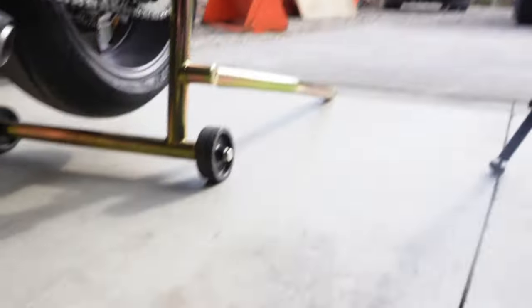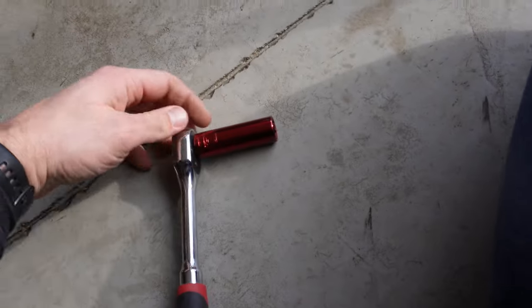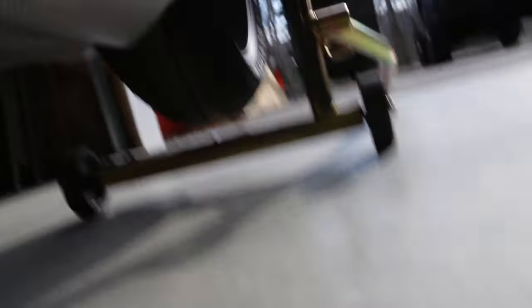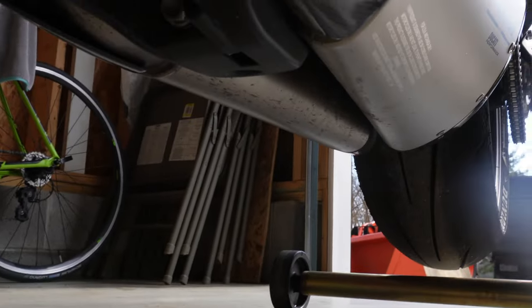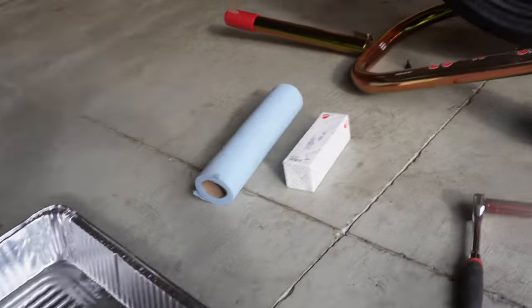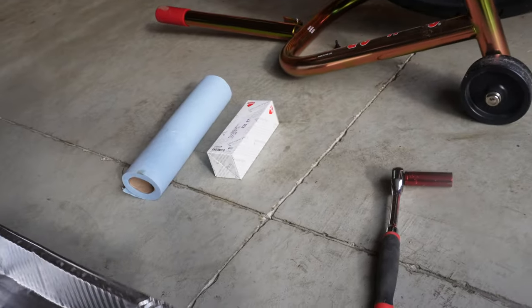The drain bolt is in a marvelous location way down here, and it's going to be a 14mm socket. I've just got a 3/8 drive here — deep well might make it easier just to get more clearance with the ratchet. Make sure you've got a drain pan and some towels. There's a filter too — I'll show you the part number in a minute.